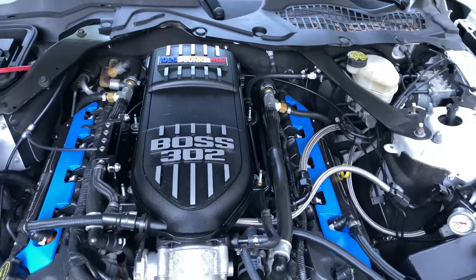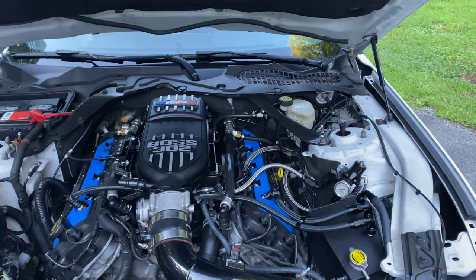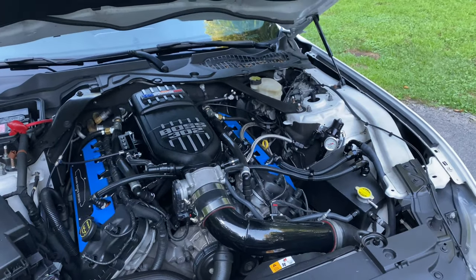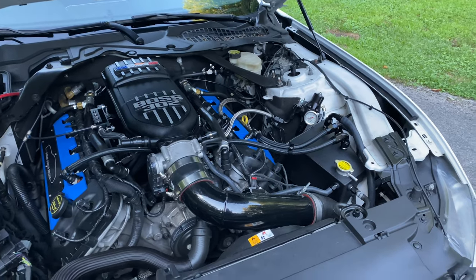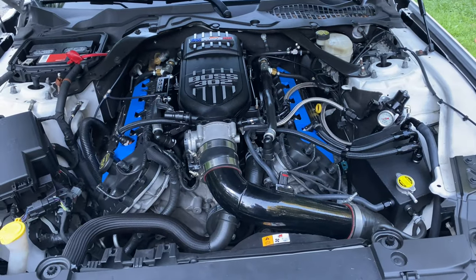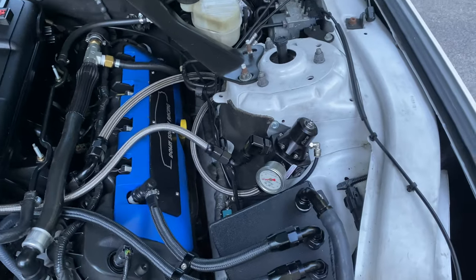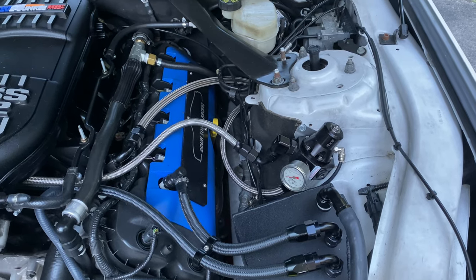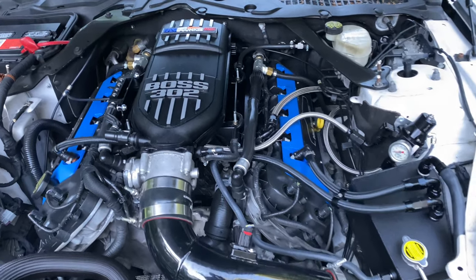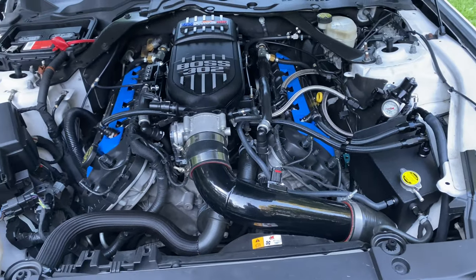And the fact that this supports over 35 PSI boost, I mean, we're talking 1500 plus wheel horsepower cars, that's incredible. I think Joe Holt has run deep eights, maybe even sevens on this, so it's very well proven. And pretty much everything other than that for any boosted Coyote guy is going to work well. I mean, this would obviously work for a Centrifugal blower guy as well, but if you've got a PD blower, obviously you're not going to have one of those. But this definitely cleans things up. The B&L Fab catch can and coolant combo. Definitely want to go to a Fore fuel system, guys, if you haven't seen some of their stuff. ID, Injector Dynamics injectors are my personal go-to. I just think they're the best. I got 1300s. They go all the way up to probably double that. I think 2600 plus, but I know they have 1700s and stuff like that.